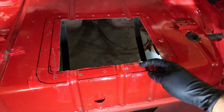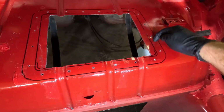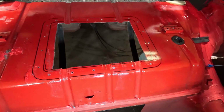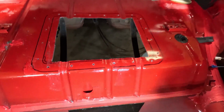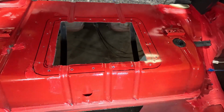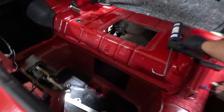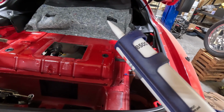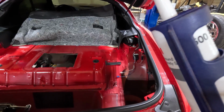So I'm going to run some seam sealer here. I'm really going to pile it up here and then put it in between each one of these, almost like a caulking. I'm sure you could use that. The 3M seam sealer is pretty expensive. But I'm going to scuff this area up real quick with a Scotch-Brite, and then we will get some seam sealer on there and start locking this thing down. We are ready. I'll try to list this in the description if I can find it. I actually bought it through my body shop guy, but you should be able to get it on Amazon.